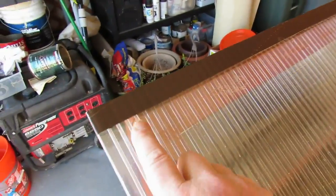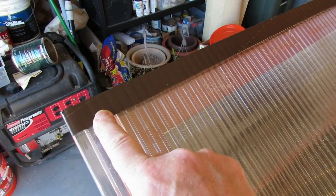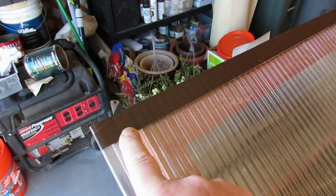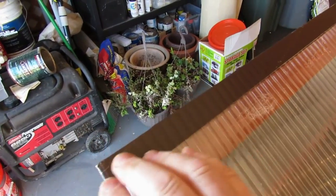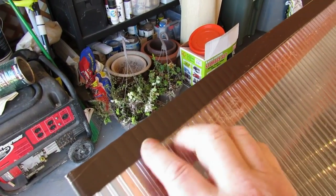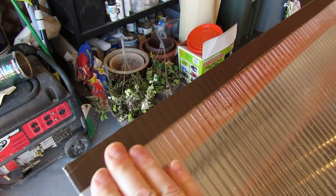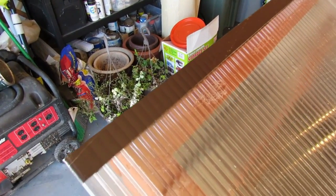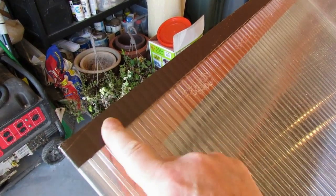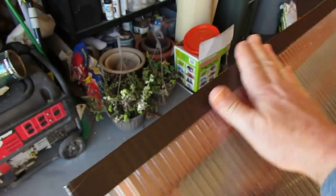So what I decided to do is up here I put in a row of aluminum ducting tape. This stuff is thin, the adhesive is really good on it, and all you do is run an inch line along here so you can put the tape in nice and straight, lay it in there nice and smooth, and fold it around the back. It'll stick real nice. Then all you do is tape this off with some masking tape and newspaper and spray it with the paint that you use down here on the panel. It takes real nice and gives it a real nice effect.